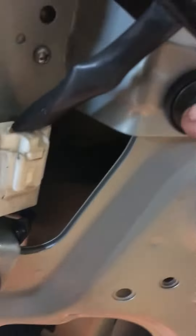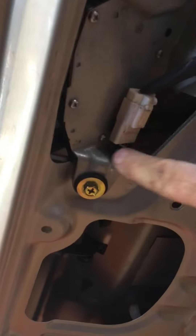The motor comes apart quite easily and right in there is a little tiny snap ring, a washer and an oil ring. What I did was I removed those and on this unit here, the three bolts to remove it are here, here and here. Unplug this connector.